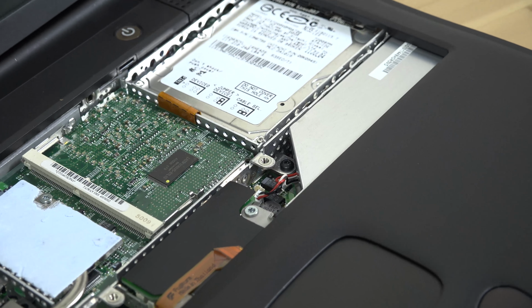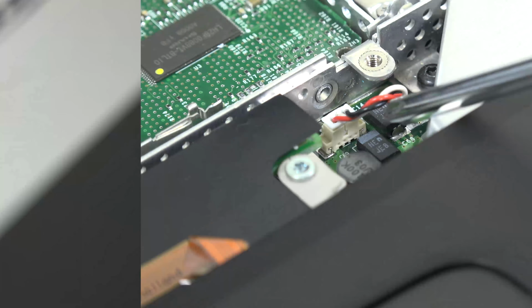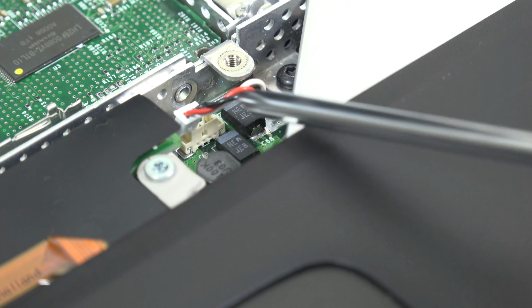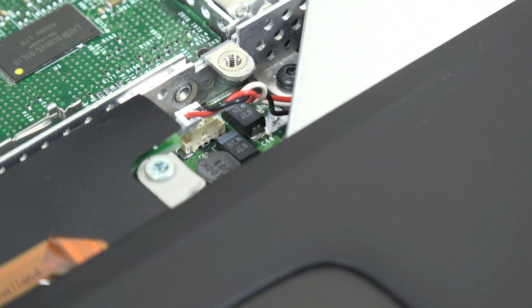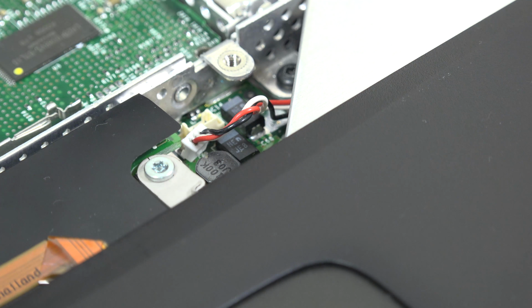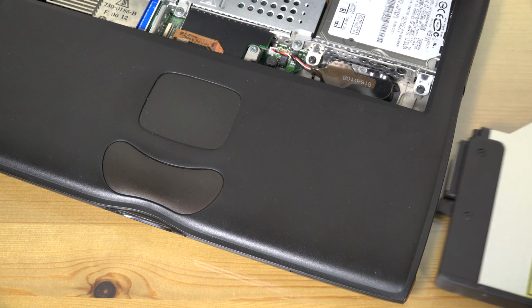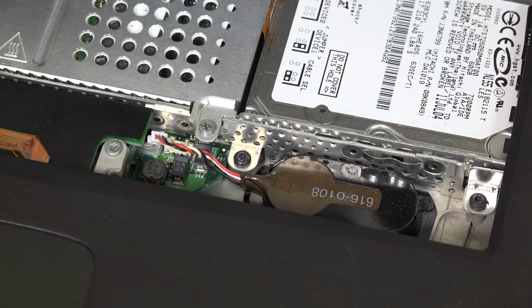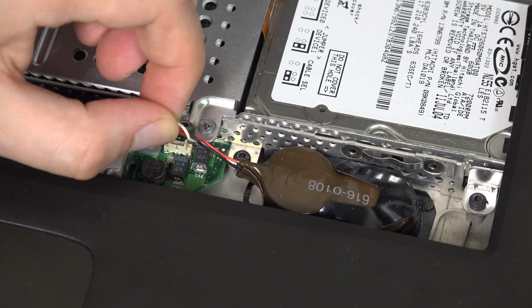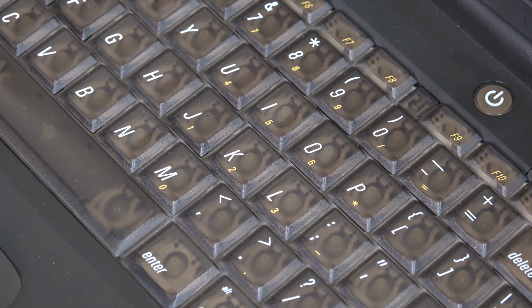One peculiar quirk of the Pismo is that often it won't boot with a dead clock battery. The little socket that connects the PRAM can be accessed under here too, and pulled out without any fuss. This issue is well known in Mac circles, but often enough, regular people selling their old equipment will have no idea. A non-booting Pismo will therefore often be listed as not working, despite the only reason for not booting being this tiny issue.